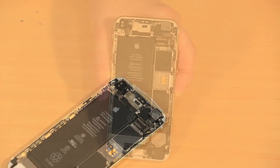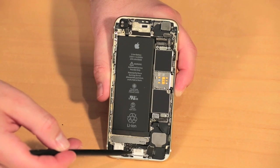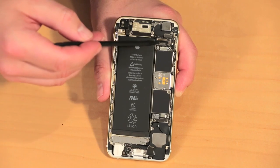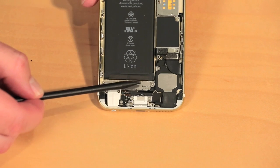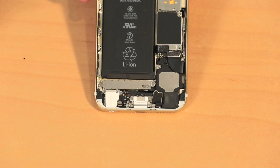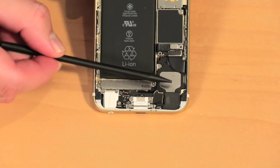Now the overall hardware layout is the same as on the iPhone 6. There's a speaker and Lightning connector assembly at the bottom, battery along the left side, motherboard along the right, and the camera assembly at the top. One change we can see, however, is Apple's new Taptic Engine. Sitting below the battery, it replaces the older phone's vibration mechanism and is slightly larger, which means the speaker next to it needed to be just a bit smaller.